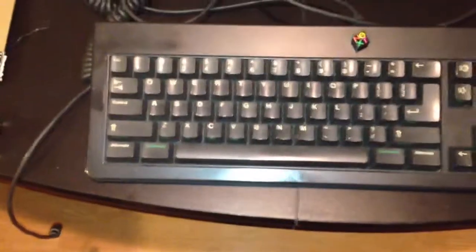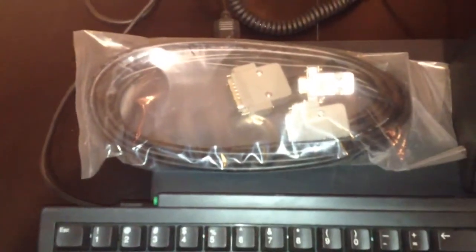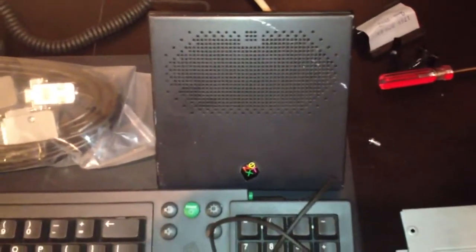And on this one there's actually dual command keys. I'm going to hook this up to a flat panel using ADB. We've got a custom cable that goes DB19 to VGA, and it's a split Y cable where one end will go to the NeXT ADB sound box and then hooking up to a Dell 20-inch flat panel. Now for the non-ADB version, I'm going to hook it up to an in-the-box NeXT 17-inch Sony 4000A monitor that I will bring out of the box when I'm ready at that point.